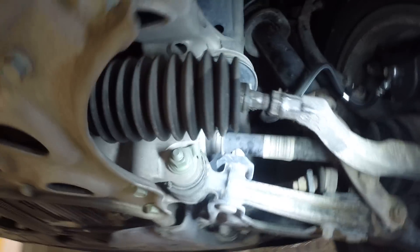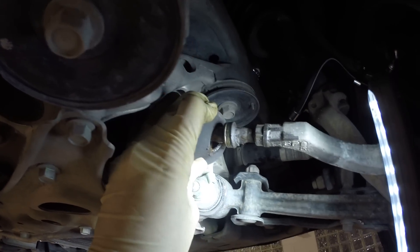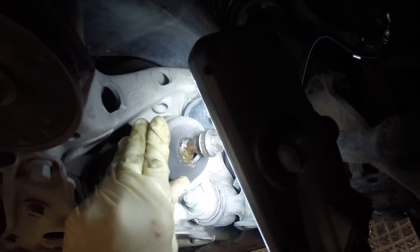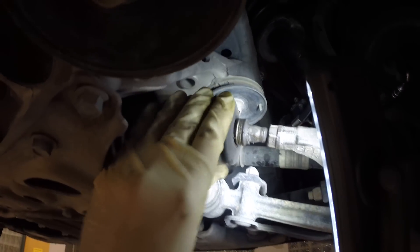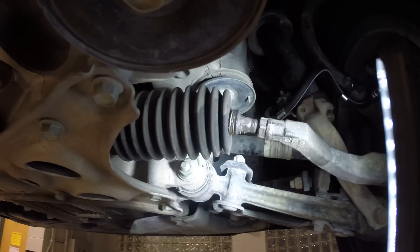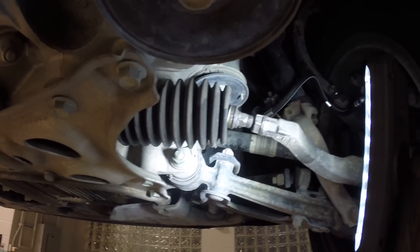All over the place, making a big mess. If you go over to this side, it's not leaking over here, but we have the exact same situation where the boot's torn — so this is how the other side started out. That boot was torn, dirt and debris and other nastiness got up in there. See all that crud, the dirt, the water, the rust — that's because these boots were damaged. Now if the boots would have been replaced before they actually broke, we wouldn't have the problem, and we probably wouldn't have a rack that is leaking.